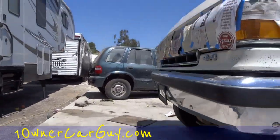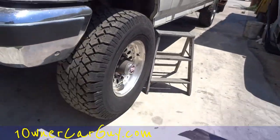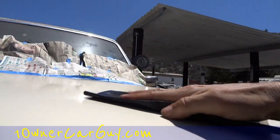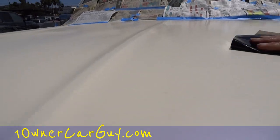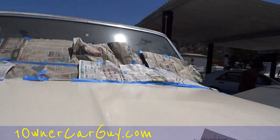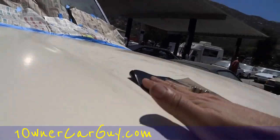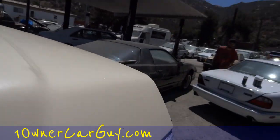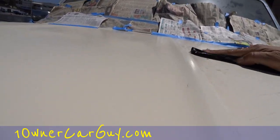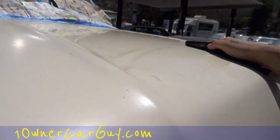And the story of the day is, he ain't got no soap in there. No soap. And it is a little bit easier with the soap. And I am gonna lightly scuff this up with 400 again. And the more water you keep between it, it does get it cutting a little better. And it'll keep your paper in a little nicer shape too.